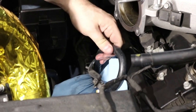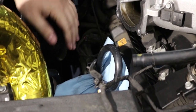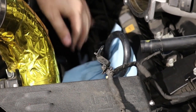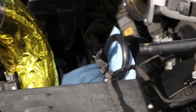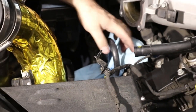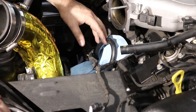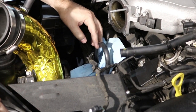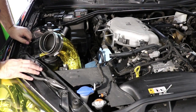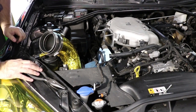Once you get the clamps back on, give it a good tug to make sure it's not loose. If it's loose or comes off, reposition everything — make sure the clamp is on after the barb and the hose is slid all the way on as far as it'll go. And that's it — that's your coolant bypass. Super easy. This is a common mod on almost every car; it's not Genesis-specific. There's data I logged and tested — link is in the description — and it definitely provides a significant improvement in intake air temperature reduction, meaning a lot cooler air going into the manifold, which of course means more power.